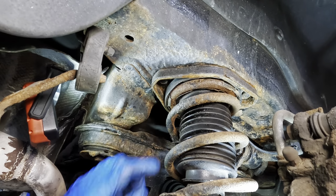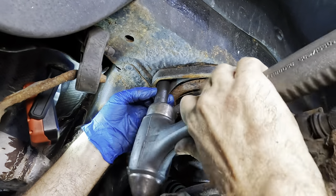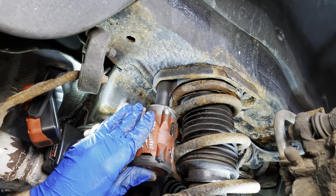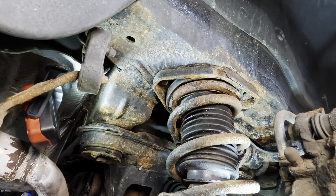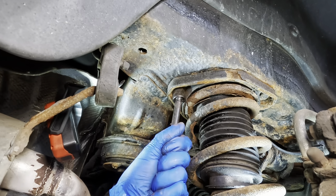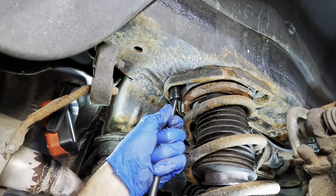Okay, I think that's a 16 millimeter bolt up there. Again, it's all crusty and flaking apart too. It's gonna be more hammer socket action here. Yeah, that's 16 millimeters. It might be 15. I guess we're gonna find out. 16 coming in, and yeah, it's not that. Okay. It is the rust that deceives us. Let's try a 15. See if that one's gonna make it come loose. Negative. You know what these are? These are self-shredding oxidized bolts. Let's try a 14. That's gonna get it.